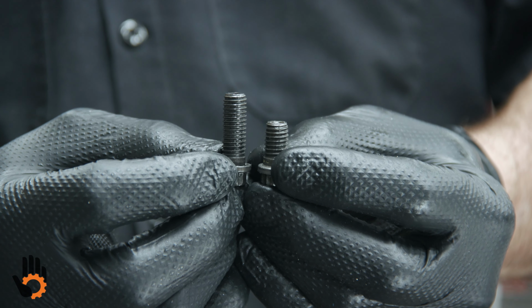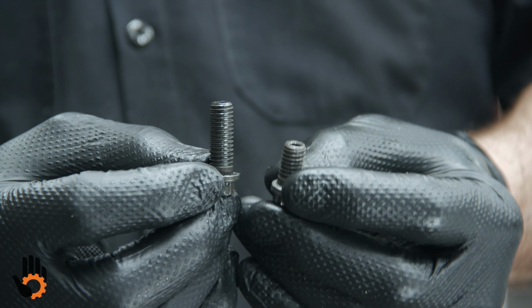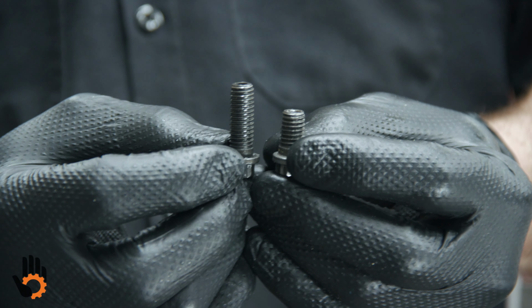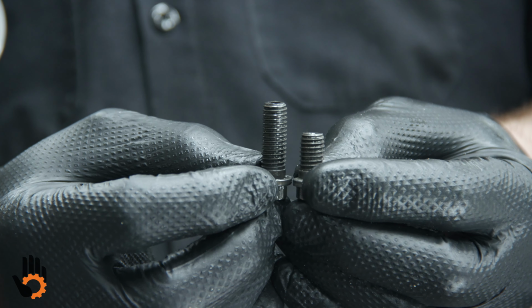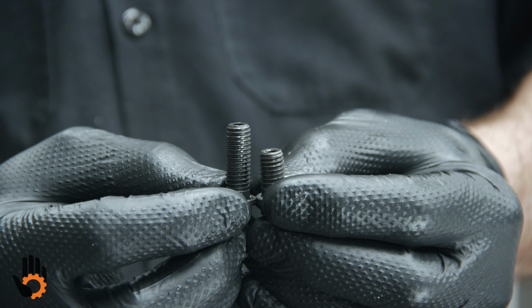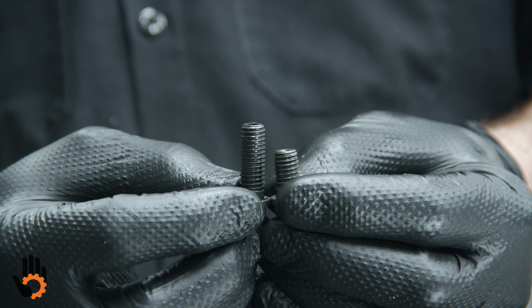So just to let you know, those are still readily available. The 400 bolt, I was having trouble trying to source that. So we use this guy, cut him short to match the 400, put him in there with a drop of blue Loctite, which is what I do on the final assembly before I torque it down.